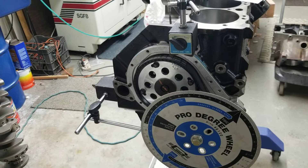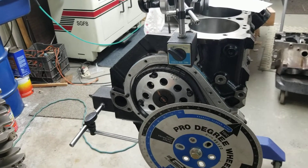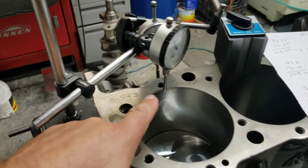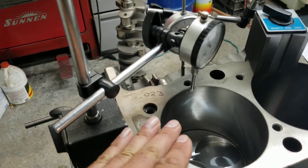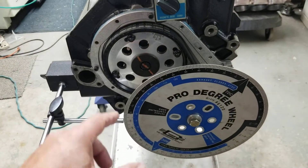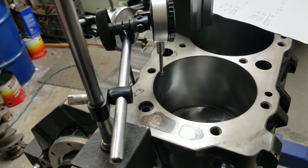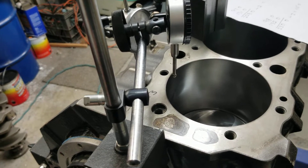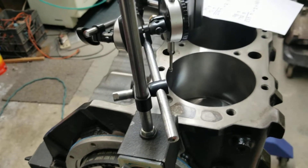We do the intake centerline lobe method for degreeing a camshaft in. What's most important is you get your absolute top dead center. That means you'll need to set up with indicators — as you can see, we have one right here — which allows us to establish the complete top dead center when that piston is exactly at the top. There's a varying degree of about three degrees of dwell, meaning the crankshaft will move three, possibly four degrees without the piston actually moving — that's the rod sweeping back and forth while the piston stays at the top.